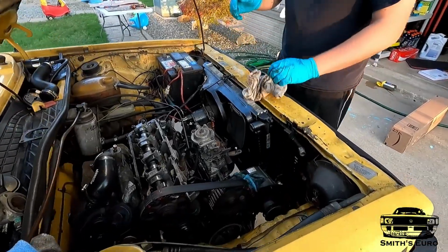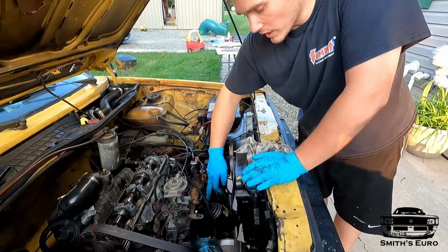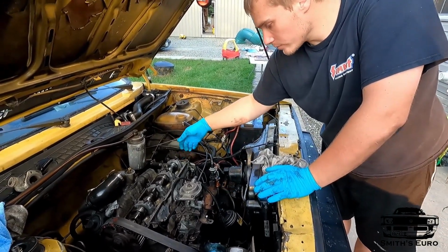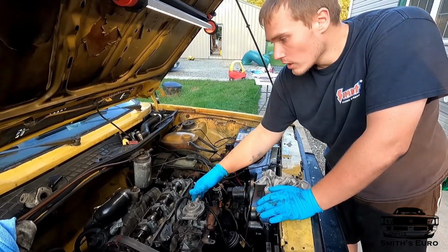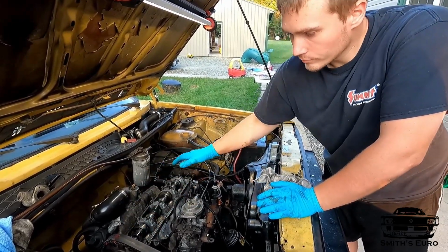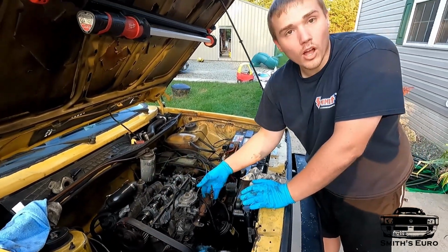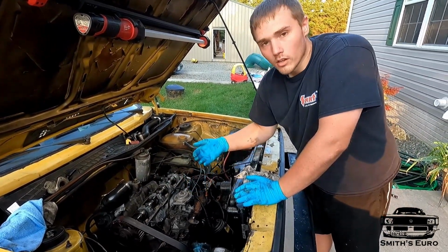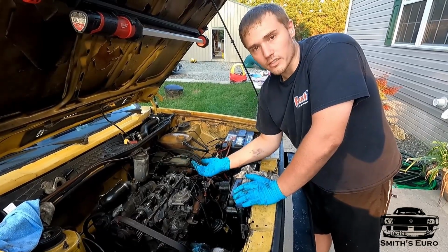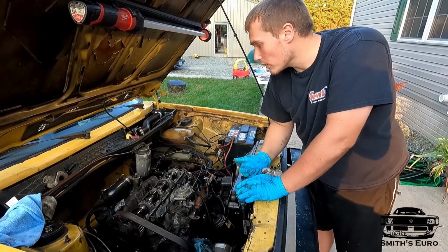So the next thing to do is to get all the hard stuff out of the way. So next I'll do the oil line and the coolant fittings. And then after the oil lines and the coolant fittings, I'll put the valve cover on, a couple of the hoses, put the fuel lines on, and then I'll prime the system. And it's basically ready to start at that point. I'll put some oil in it, obviously, but it's basically ready to start then.